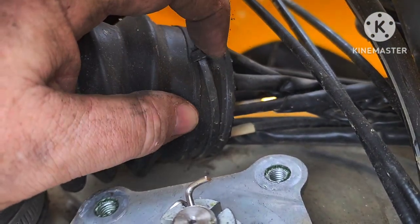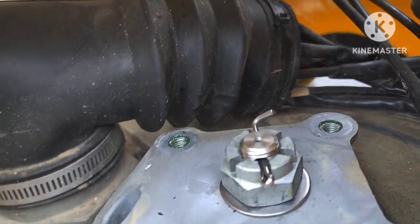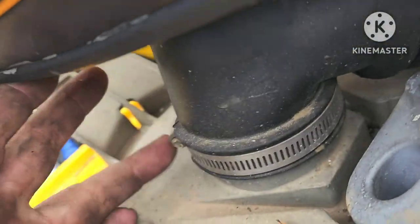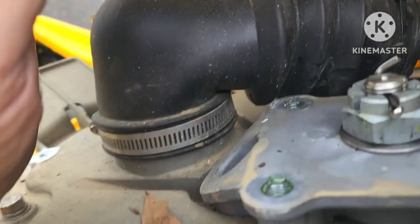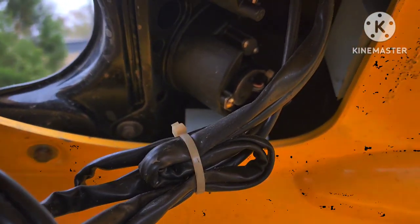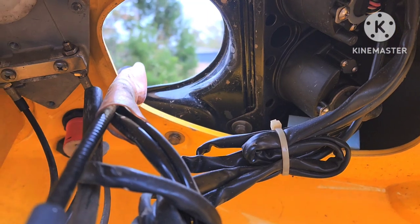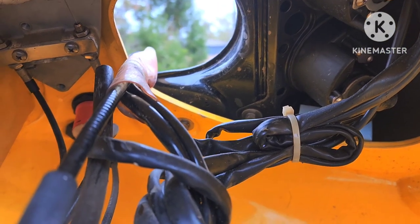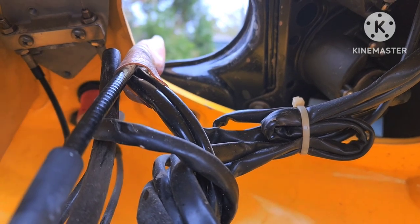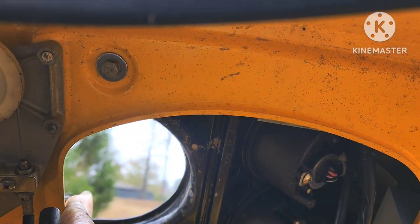You've got this boot that the wiring is in - it's a watertight boot. It's got a zip tie on it and it is glued underneath. You'll take that, cut it, loosen this clamp here, push the boot back, and get to your wiring for the fuel gauge. There's another tie wrap I'm going to have to cut right there and re-bundle. That's important to put all those back because you don't want stuff rubbing against everything that's moving under here. Three 10-millimeter bolts is my next step, and then I know there are three 10-millimeters holding that instrument cluster in.